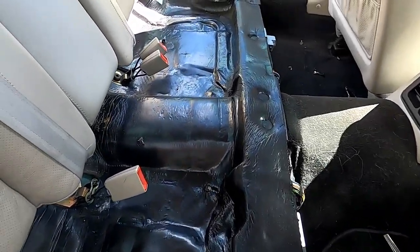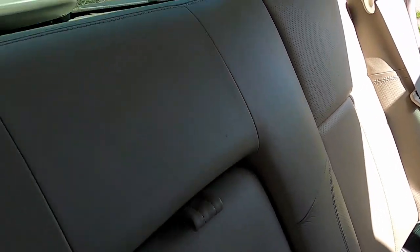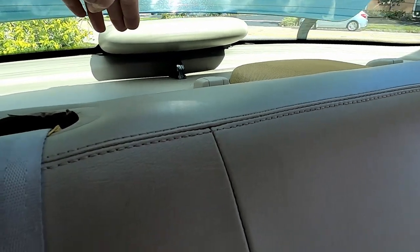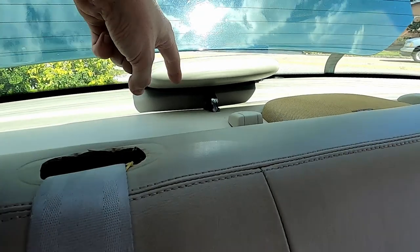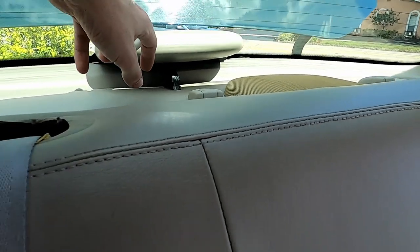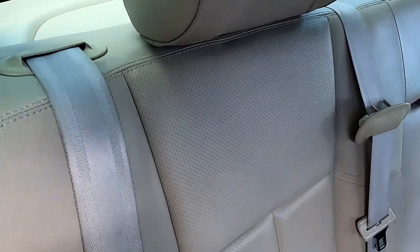I got a little bit of work done before filming. The package tray is back in — literally just the reverse of pulling it out. The only difference for me was disconnecting the third brake light, which is just a little plug tucked in the center, easy to disconnect, and that made getting things started a lot easier. I did find that the pigtail is quite short, so I'd suggest getting things started, resting the third brake light on top of the package tray, putting the connector back in, then continuing to slide the tray in with it resting on top. Much like removal, I lifted the seat up and over the seat belt braces — putting it back down was easy, just thumping on the back of the seat with my fist along the whole back to settle it down.